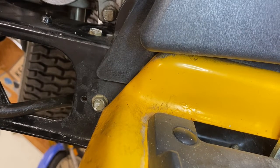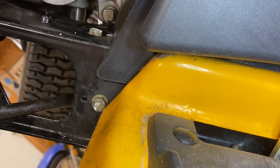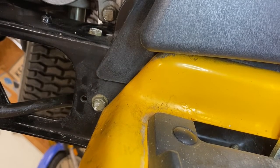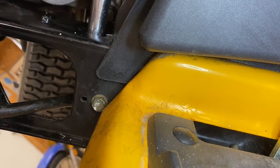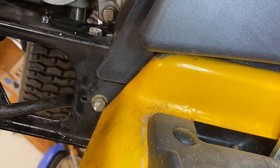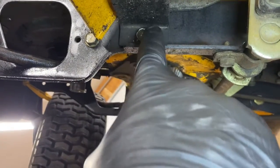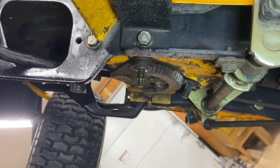In order to get that plate off underneath, you're going to have three bolts on each side. There's one right here, one up here, and one behind here. This one is blocked by the fender — hopefully yours isn't because it's a pain in the butt. Just get a half-inch wrench on that to take it off. For the one up top, if you put an extension on it, you can actually get to it and take those two off.